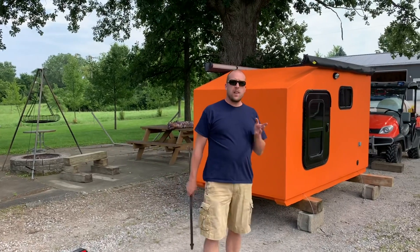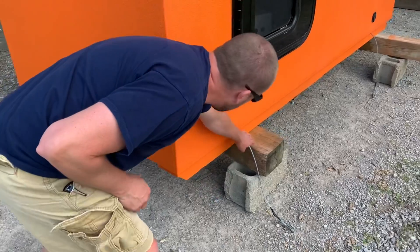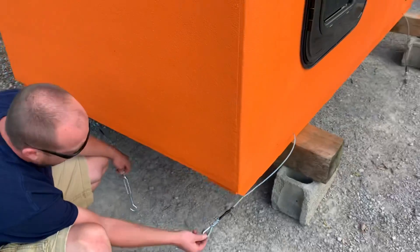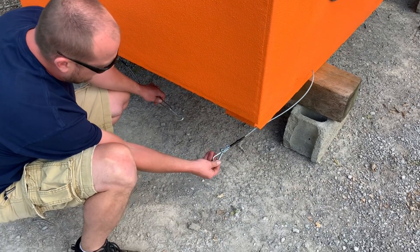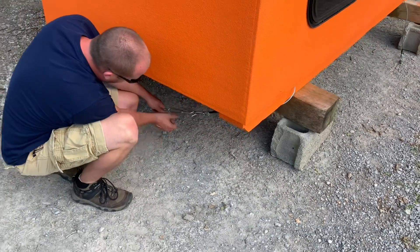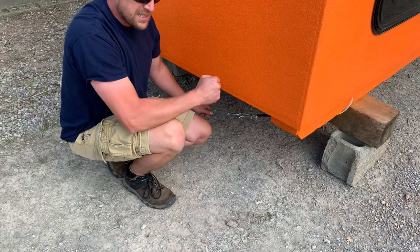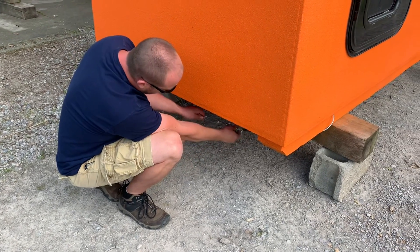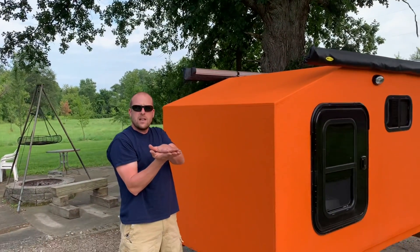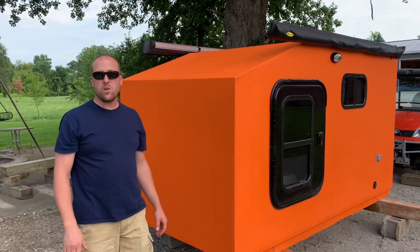I want to show you guys this while I have the camper off. I didn't do a whole lot of detail on how I secured it to the trailer, but I'm using a turnbuckle and a cable. You wrap it around the bottom of the trailer on both sides and hook it up to itself, buckle it down, and there's a lock nut on there that locks the turnbuckle in place. You don't need a tremendous amount of force — you're counting on the friction between the deck of the trailer and the bottom of the camper to hold it in place. It seemed to work really well on our first trip.